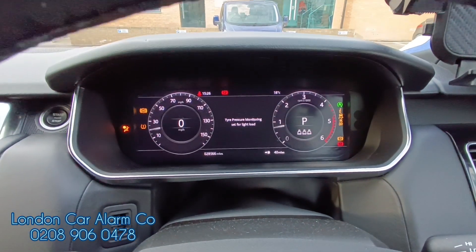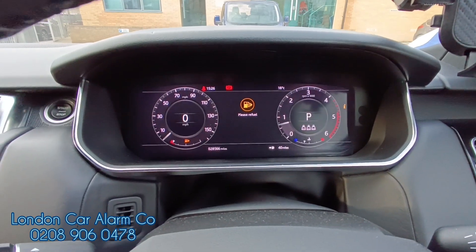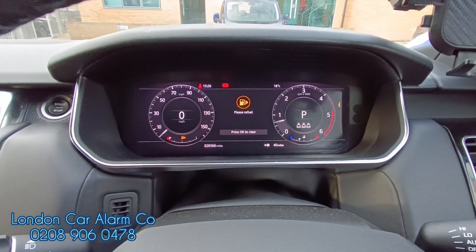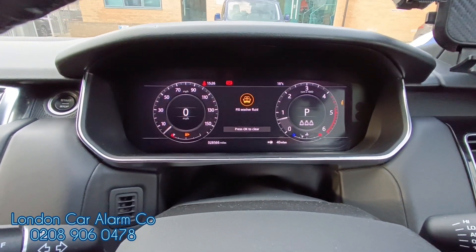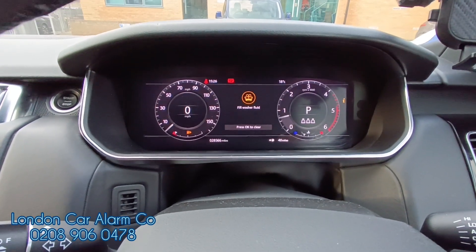Okay, and then you've got to drive away. This is the most common phone call we get for customers that neglect to put it in valet mode, at the car wash or at the service department and someone starts it more than three times. On the fourth time it just won't start unless it sees an authorisation code. This is the Starline i96 on a Range Rover. This four-restarts rule is on all Starlines — you have to go through this particular cycle.